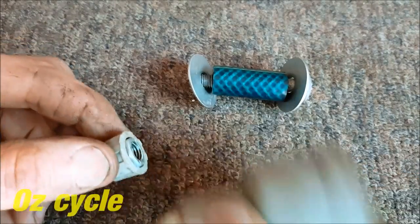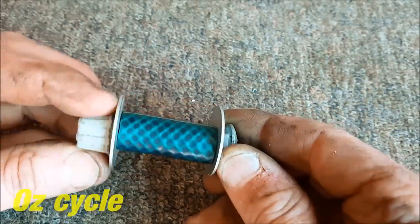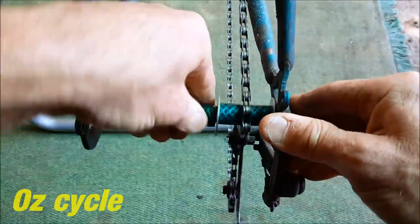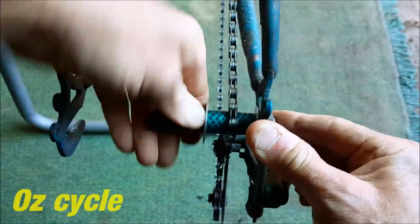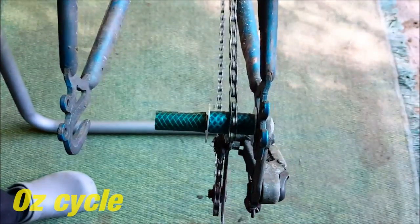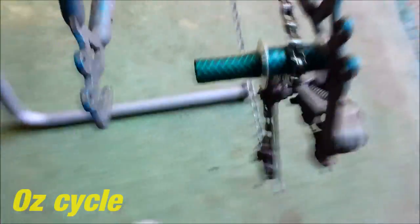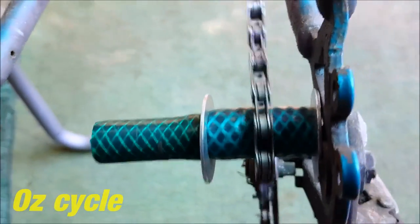Here's another sort of handle — the end of an electrical plug with the nut in it. That works fine too. Put the head of the bolt on the outside of the dropout, the big washer and the rest on the inside, do it up nice and tight, and there you go — you now have your dummy axle. Your dummy axle allows the chain to glide over easily and the chain rolls freely so you can now clean and lubricate it.